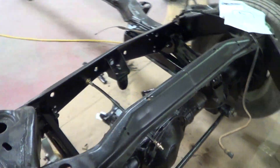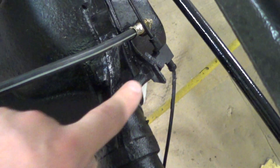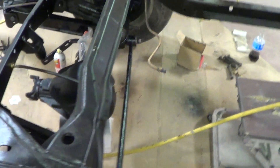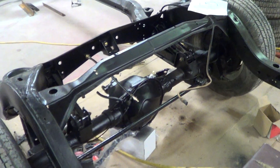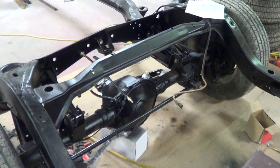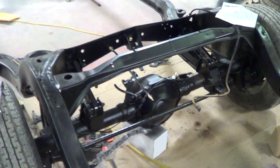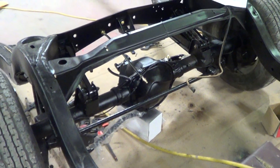There's a new brake line because the other one was rotten, and it will be hooked up in there. We're not hooking this one up yet because we don't want to pinch anything. Kevin originally had station wagon rear springs in this car, and I'm not a fan of that. It's fine if you're not putting the weapons box and stuff like that in there, but this car is getting the weapons box, and we want this thing to sit tall in the rear and not sag down a lot. So we're putting the variable rate springs in it like I do on all the cars.